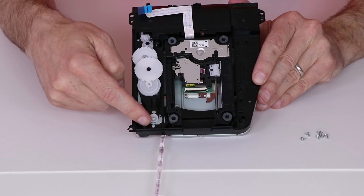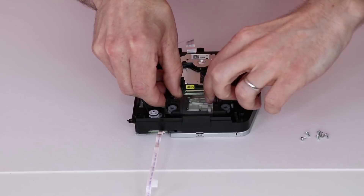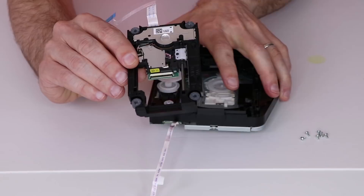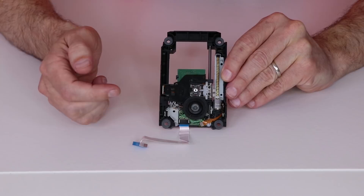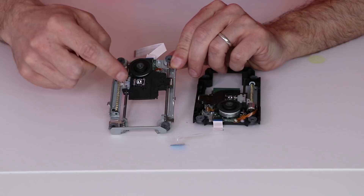For anyone curious, this is the motor that turns the gears which make the rollers turn and pull your discs in and eject them. With all the screws removed, we can remove the laser carrier from the disc drive — just pull up on it, there are no screws holding it in. It's held on with rubber pieces, so make sure those stay installed as they prevent vibration and keep disc reading smooth. Now we just have the carrier with the laser assembly. This is the carrier for the PS4 Pro; this is the carrier for most other PS4 models.